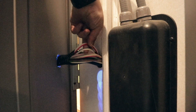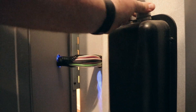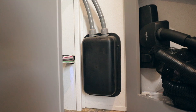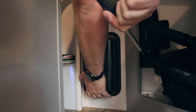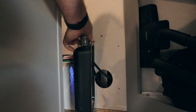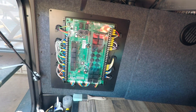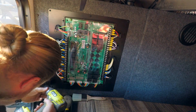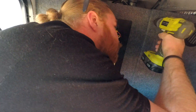At this point I'm looking for a 12-volt power line I can splice into. My first choice was to look at a bundle of wires, but I didn't feel confident I could pick a good power wire and ground — they weren't clearly labeled. By pulling back a black box I found a pass-through into the basement storage, and in there on the other side is basically the main command center of wires, which is very standard for a Keystone. There I could find a labeled aux 12-volt power and a 12-volt ground coming right out of the main unit and connect my cables to those labeled wires.